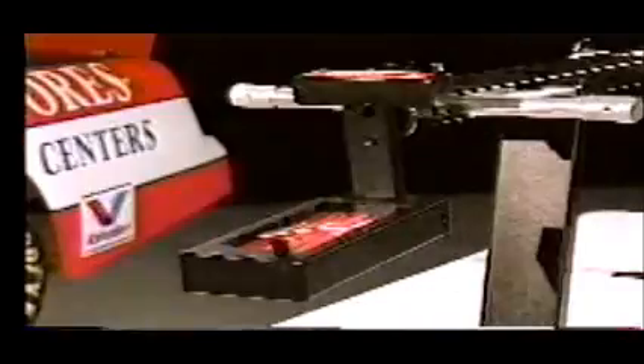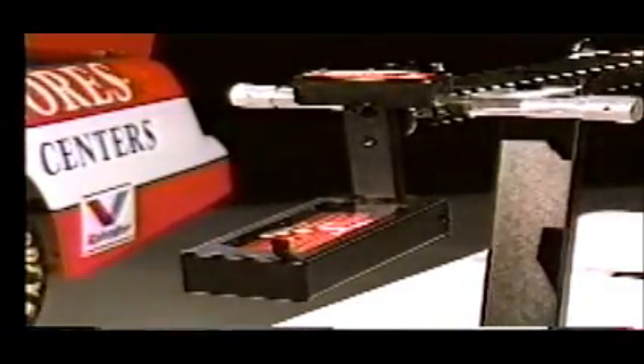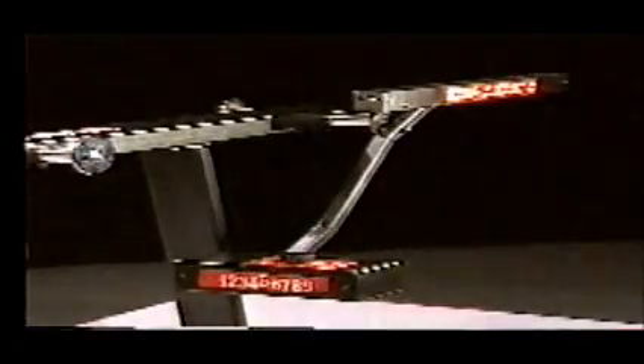The components of the system are: TR40 Calibration Bar — this bar is used to check and calibrate your system anywhere, and also provides storage of the gauges and toe guns. TR30 Easy Check Angle Gauge — this gauge is designed to give highly accurate caster and camber readings of plus or minus six degrees. TR36 Left and TR37 Right Laser Guns give you readings for rear steer, total rear toe, and front toe.